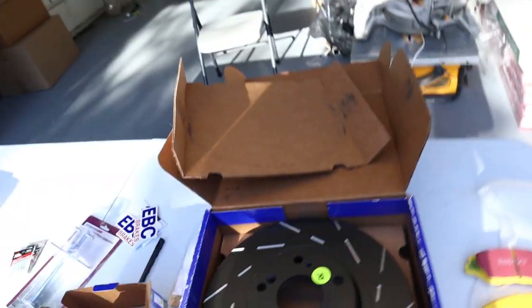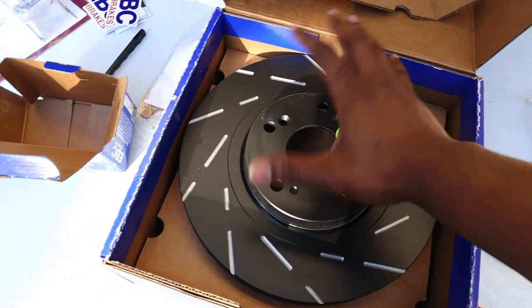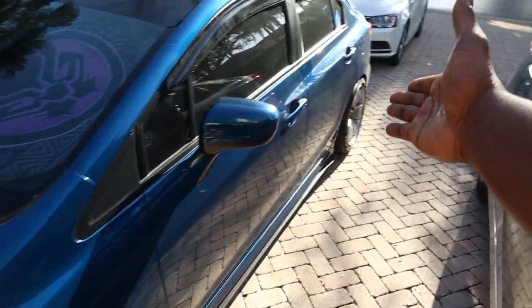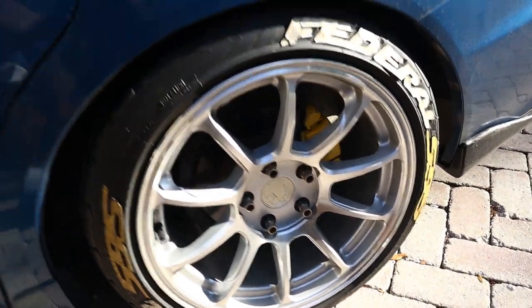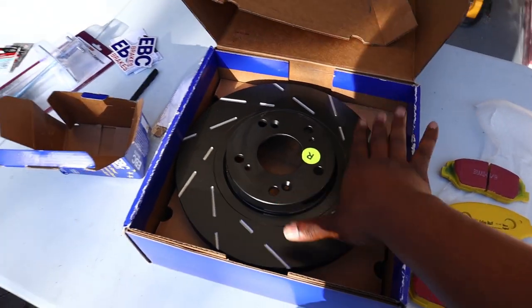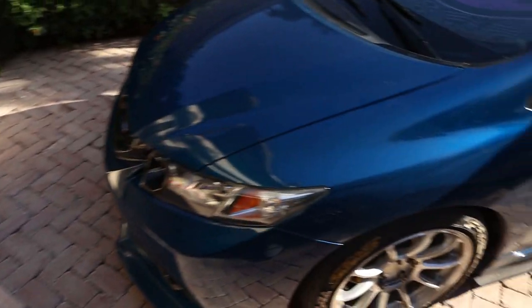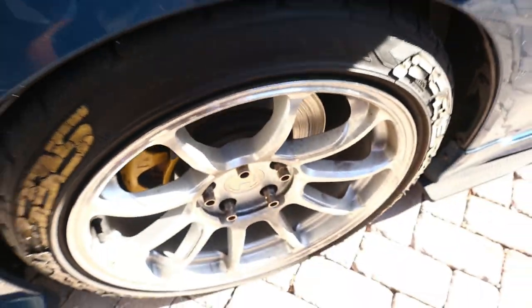For the rotors I did end up getting EBC rotors as well. I thought about getting a StopTech but I didn't want to pay like $250 just for some rotors. I did get slotted — I didn't want drilled because if you bring too much heat to a rotor you can end up cracking it. I got some nice slotted ones. This coating material rubs off as you brake, so don't think I'm gonna have a black rotor. I didn't buy rears, so the rear rotor is gonna stay the same. I'm changing out the fronts because the fronts are definitely destroyed. As you brake, this wears off, everything turns silver, and this stays black to keep a clean look so it doesn't rust, which I really like.